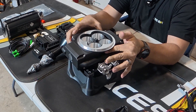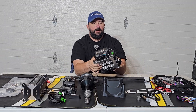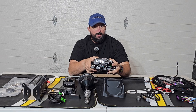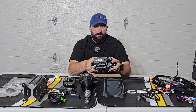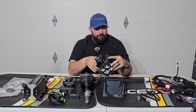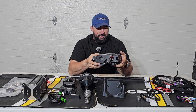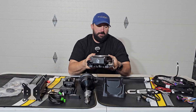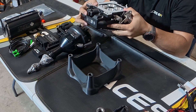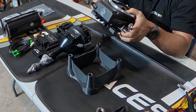There's a slight progression to the linkage that helps with general drivability and tip-in. On the back side there's a green port — that's for dual quads or possibly the CAN hub. It has two fuel inlets on the side opposite the throttle linkage. There are no ports on this side. The IAC is on the back of the throttle body.